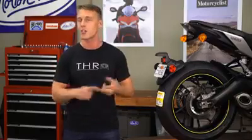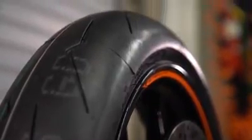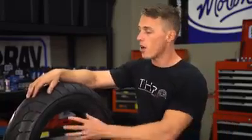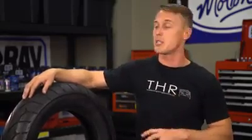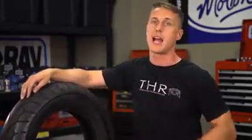It's true, back in the day, manufacturers used to apply lube to help the tires pop out of the molds, but these days, that's just not the case, at least not for Pirelli and other upmarket brands. Nowadays, the molds are actually polished, or they have an anti-stick coating kind of like Teflon on a frying pan, so there's no lube needed. That sheen you see on new tires is just the way fresh rubber looks when it comes out of the mold. That said, release agents are occasionally smeared on the sidewall area of the molds to ensure that the script and logos are crisp and legible. But no mainstream tire manufacturer puts anything slippery on the tread area of the tire.